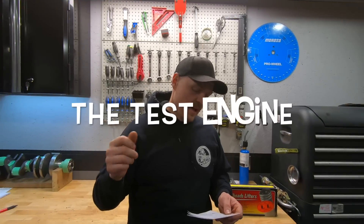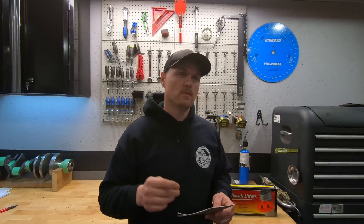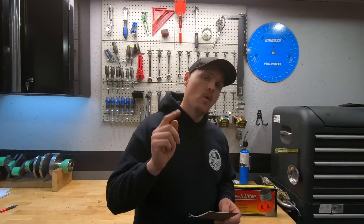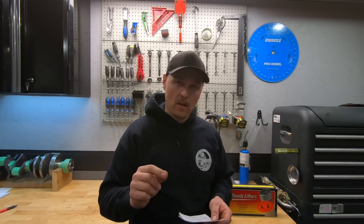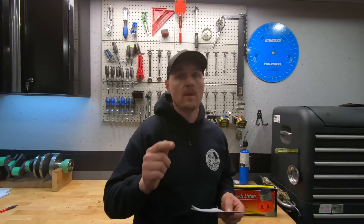So it's a 406 with stock dish pistons - only about 9.3 to 9.4 to 1 compression. I've swapped to Vortec heads on it, it's got a dual plane intake. It's really nothing fancy, but it sounds really awesome with this camshaft. It only has 11 inches of vacuum. This is at 800 RPM, 22 degrees of timing at idle with no vacuum advance hooked up. Take a listen to how this camshaft sounds - note this is with the Delco lifters originally.